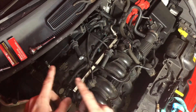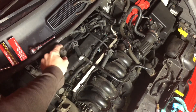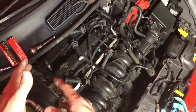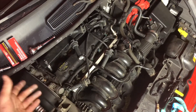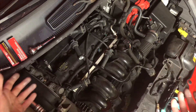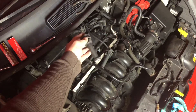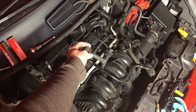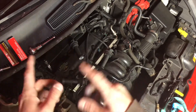You can take the coils — here's number one — and once you change the spark plugs, you can swap this coil over to cylinder two, three, or four to see whether it's actually cylinder one or one of the coil packs causing the misfire. These spark plugs are Ford Motorcraft, which cost about ten dollars per plug; off-brand will run you three or four bucks. The coil packs are a bit more — you can get off-brand for $100–$150, or vehicle-specific for about $250. They are certain lengths and go to certain sizes, but you can definitely swap them to diagnose.